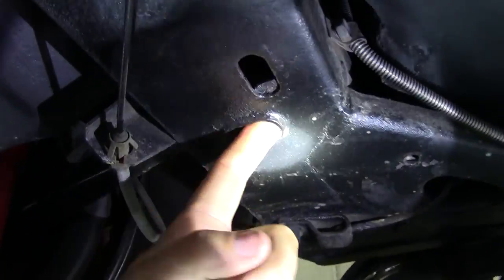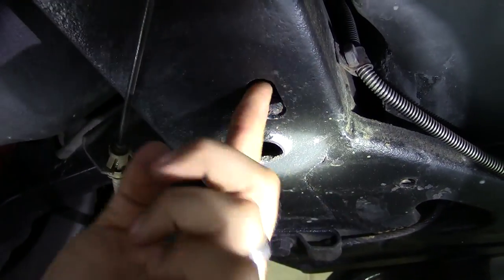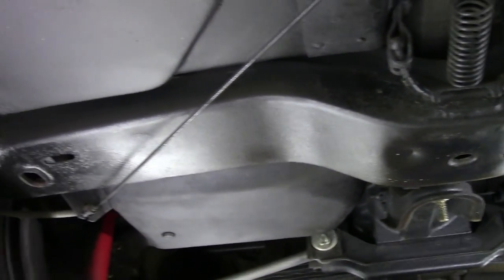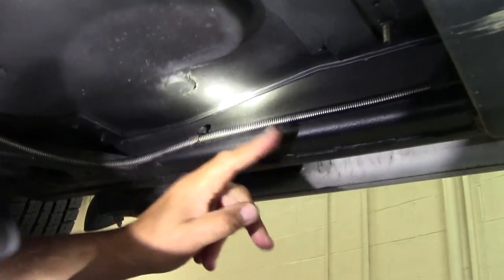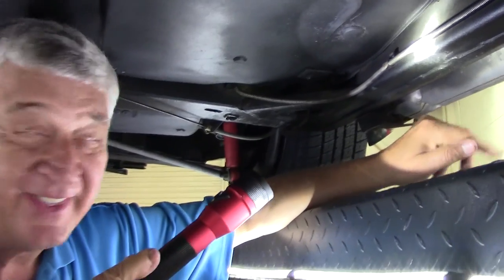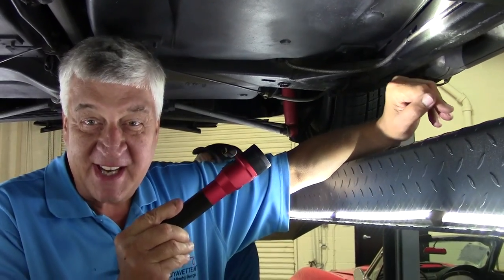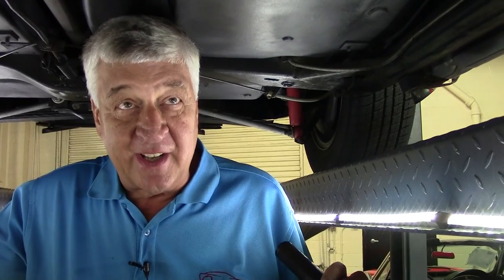As Greg was referring to earlier — the bones of the car, the frame. If you stick your finger in the frame, on a lot of cars you'll feel that it's scaly and the metal is thin. This one is nice and thick, so you can tell it's never been exposed to any kind of elements that would rust the frame from the inside out. And of course, if you see welding going across the frame, that's a problem — that's where a Corvette was cut in half and put back together. We don't have those offered at Buy-a-Vet. We only offer Corvettes with good frames that are safe. Thank you for watching the video — hope the information will be helpful in your hunt for a Corvette.